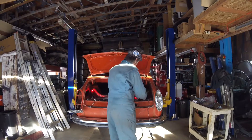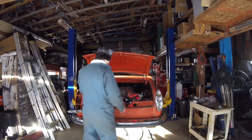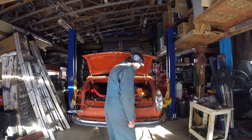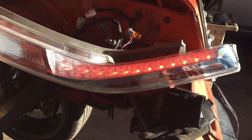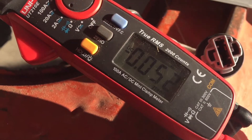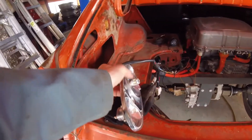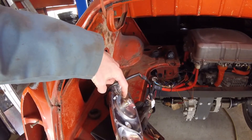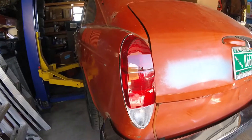My wiring sucks. So about 0.19 amps for the stoplights and 0.05 amps for the tail lights. I wired up the VW housings with the pigtail from the leaf. I also have an LED stop and running light bulb right there — 1157, but it's an LED.